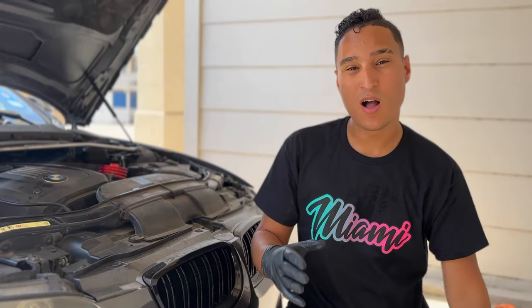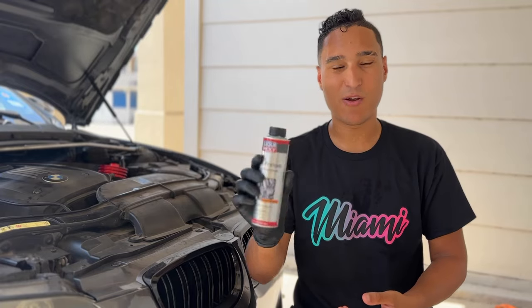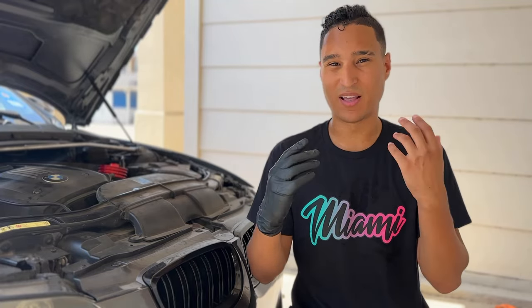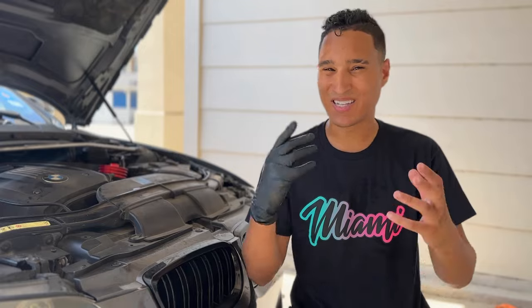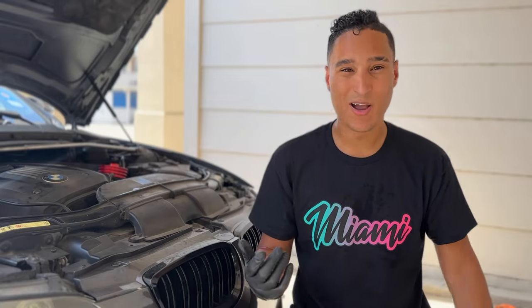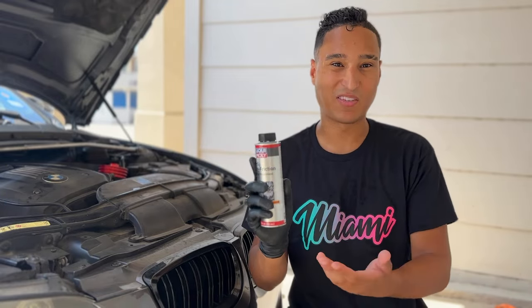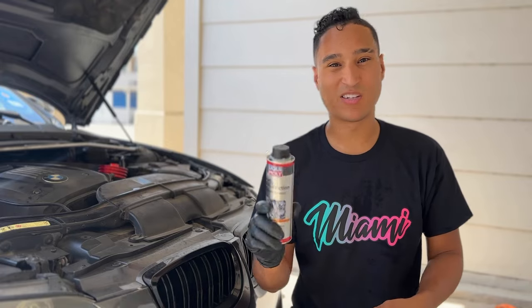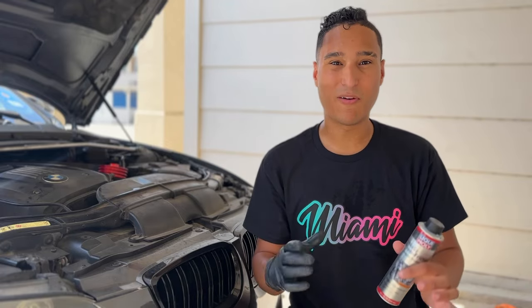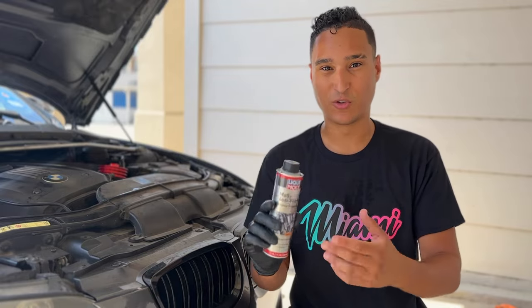The audio clip you just saw was without using the Liqui Moly anti-friction lubricant. You can hear there's a little bit of lifter tick and you can still hear the metallic N52 sound. The N52 always has this little metallic tick to it really no matter what you do, and this is the only thing I've found that's been able to fix that. So let's go ahead and pour this into the car and I'll show you guys the difference — you'll hear just how much quieter it is with this anti-friction solution.